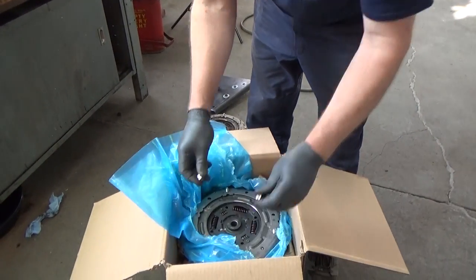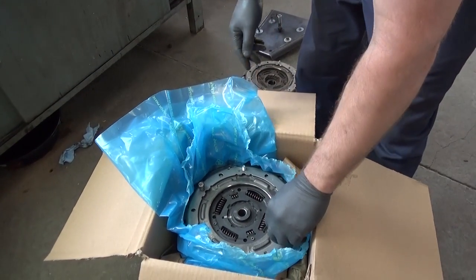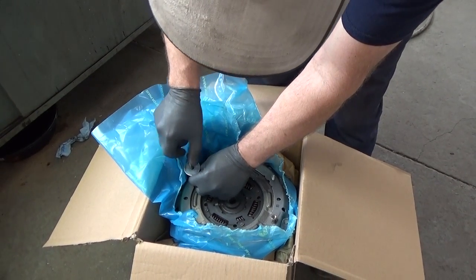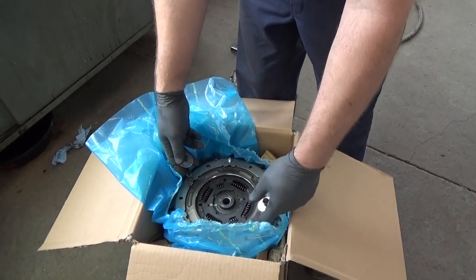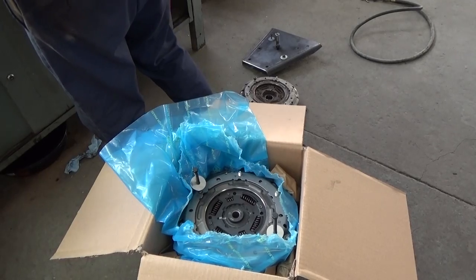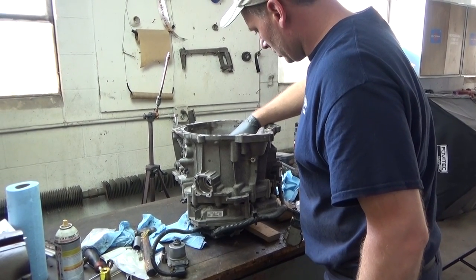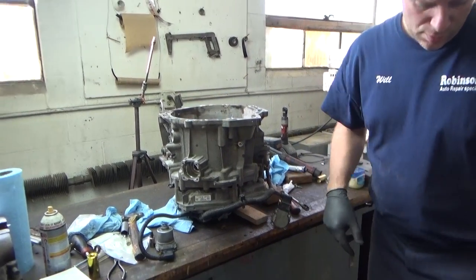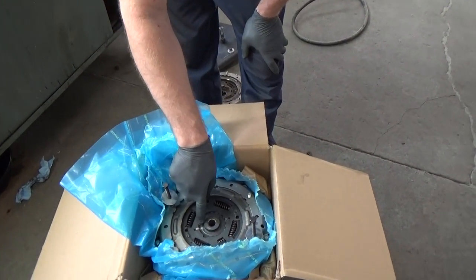Alright, so next with the new clutch, we're going to take these double nuts that we fabricated. I said before, guys, we want to make certain that everything up here is ready to go. It's stable. The Z washers are centered. We're going to take and remove this center spline collar. You can see there's a mark. We'll line that back up later.